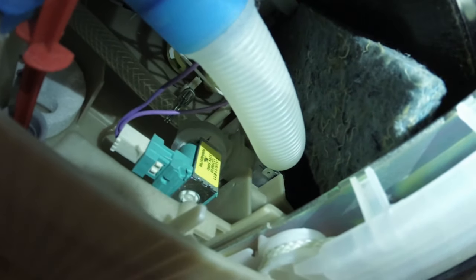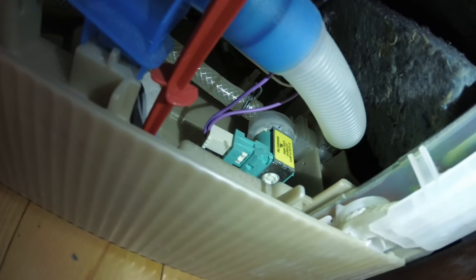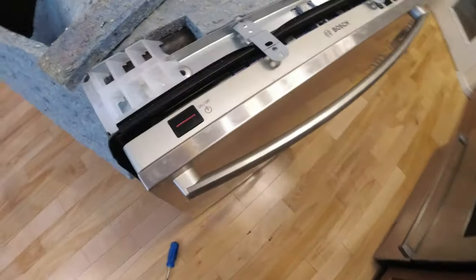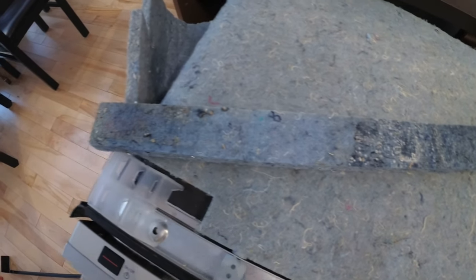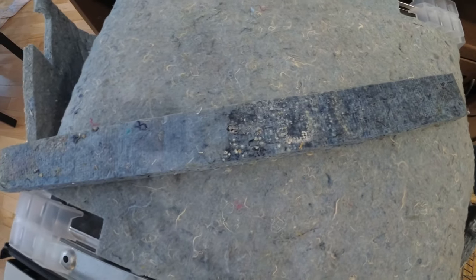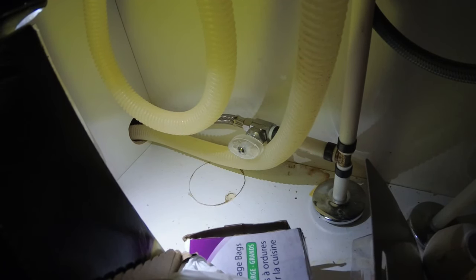Underneath the front there was a bezel. You can see a braided steel line coming up from the back — that braided water inlet line is coming in, so this green valve right there must be our water inlet valve. This piece of insulation from the front bezel has been leaking — you can see a little bit of mold on it. That's the water valve for the dishwasher, so I'll shut that off and start looking at the water inlet valve installed in the dishwasher.